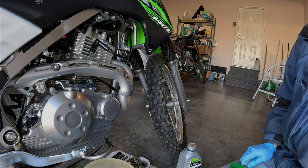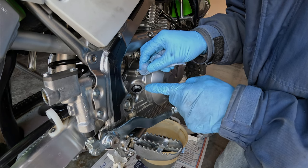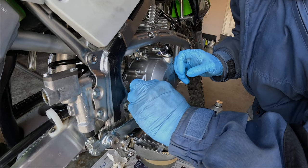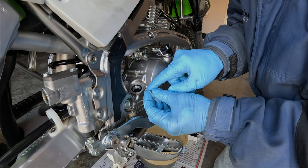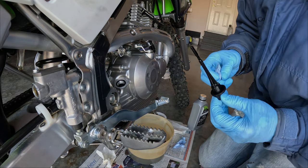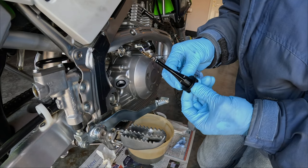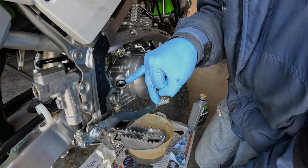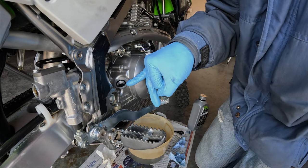The next thing we need to do is pour the oil into the engine. There's the oil filler cap. Clean around the oil filler hole, being careful not to knock any dirt into the hole. You can see the O-ring there — here's the filler cap slash dipstick. I'll clean that off as well, and clean the mating surface. Most bikes I just pour the oil directly from the container, but this one's a little recessed inside, so it's harder to pour without spilling, so I'll use a funnel here.